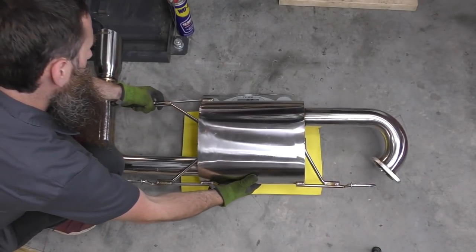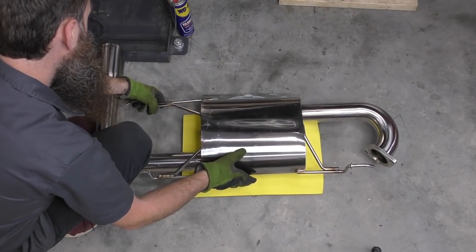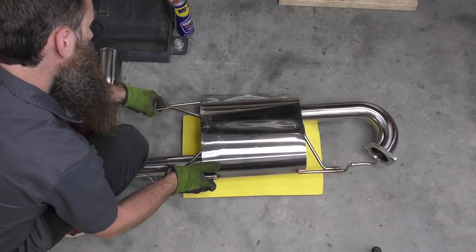There's a couple of other areas where I think we might actually see an improvement. We may see a reduction in weight on the aftermarket exhaust. Typically, an aftermarket exhaust does weigh less than the factory one. Also, this car has 160,000 miles and it appears to have the original catalytic converter. Over time, the catalytic converters can get a little bit clogged, not enough to trip a check engine light, but putting a new catalytic converter on it, even one that's not a performance cat, can improve our airflow.